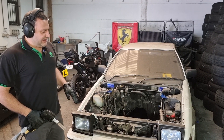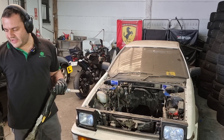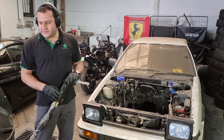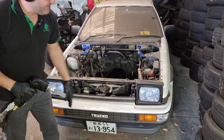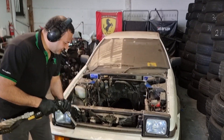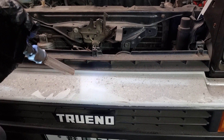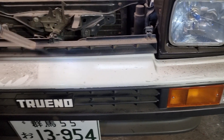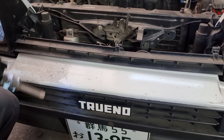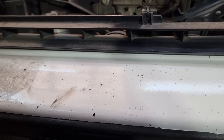The finale of this video — I'm really curious to see if we can use dry ice blasting on paint and at what point it's going to damage paint. I have the pressure set on the highest, using about 400 grams per minute of dry ice on the Micro Clean. So let's do the paint on the bumper, then we're going to play around with the plastic trim and do a little bit of work on the engine bay, maybe the glass. It's definitely cleaning the paint, but it's also pitting the paint. So on this particular car, with this pressure, it is damaging the paint.